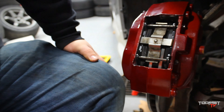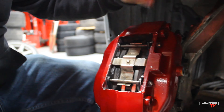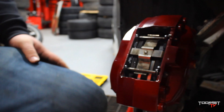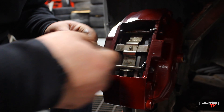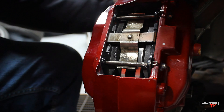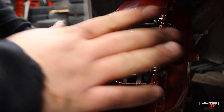So this way — you grab that shim right there, this piece here, just like that, and then you push down here so it can move freely. Boom boom — easy as one, two, three. On these slider pins, some of them have cotter pins, some of them don't. Fortunately for me, these ones have cotter pins that will just slide into the slider and you don't have to worry about them ever coming loose. Here's the second bad boy. As you can see everything is moving freely — and that's what you want. You want to see all the pads, everything be able to move freely and lubricated nicely.